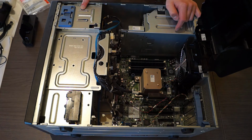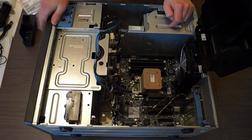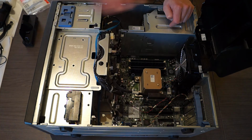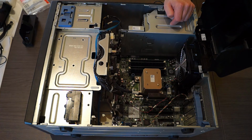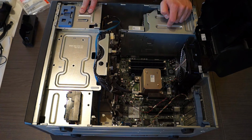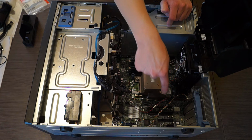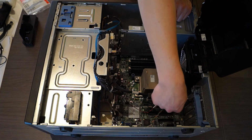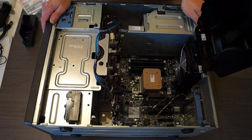Alright, so what we also have are 2 internal USB ports and 6 SATA ports. Under this is also something for the internal stuff, like how many watts you need, what's the temperature, and something you can also watch over here. We got expansion slots. We got an X8 slot here, an X16 slot over there, also an X8 and X1, and this X16 slot is only available with X8. Also every one with PCI 2.0.